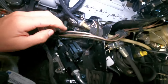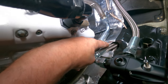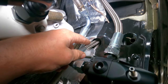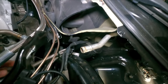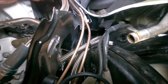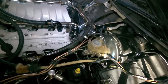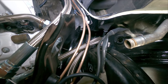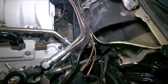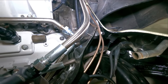Hoses are in position and it is all good. I did not change anything. The only thing I am going to do is put something underneath here so I am fully sure it will not touch in the future. This line is pretty hard so it will not really slide through. I supported it here with two tie wraps so it is together and straight through the hole. I am also going to support it there. I also enlarged those holes with a socket to stretch them so there are no sharp edges that can damage the hose. This stuff is really solid so not really a problem. It is all within the bend limit so it will not damage the inside - it can handle this angle.